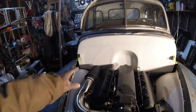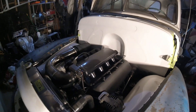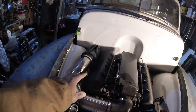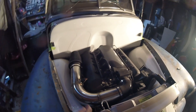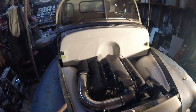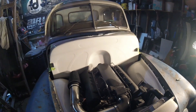I also have Holley coil pack covers — pretty simple bolt-on affairs. I didn't want to relocate my coils; I'm trying to keep this motor simple so I can go down the road. I did have to notch one to clear the alternator, and I shortened the other quite a bit to clear the firewall, because the motor is down and back. It's mounted with Dirty Dingo mounts that let me slide the motor forward and back. I do have a hood — it's in the corner — these trucks need hoods, and ultimately I do want one on.